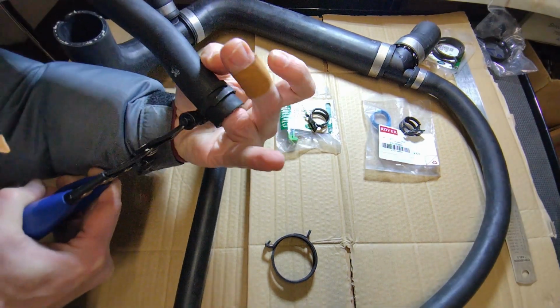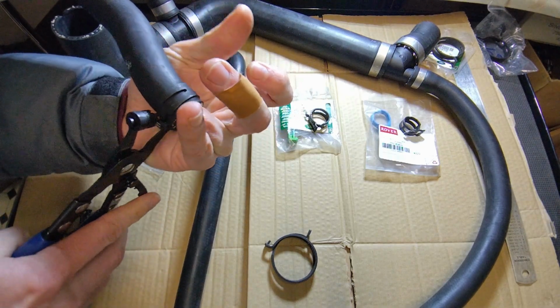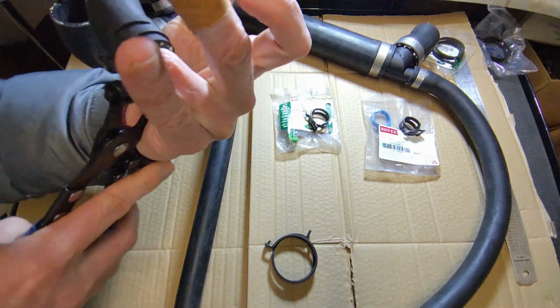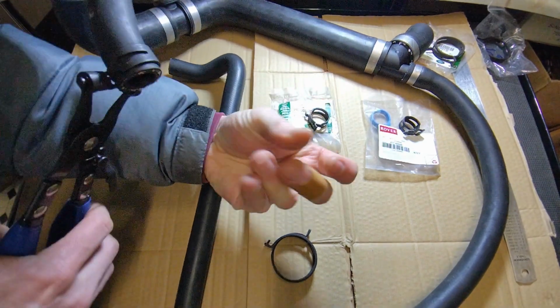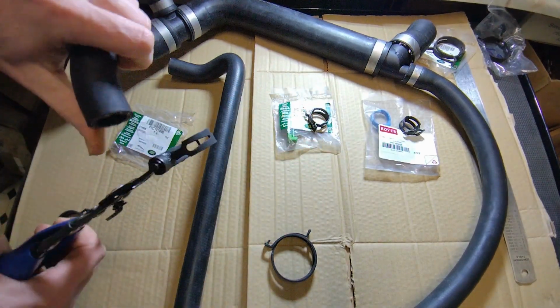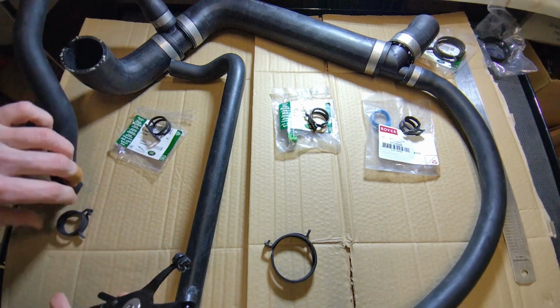I think there's a good test you can do on the pipes that are smaller. I use my ring finger and release that. That's actually quite painful. I can't get that out. The compression on that is quite strong. I wouldn't want to leave my finger there. It would start probably going pink. So that's quite a good test to see there's quite a bit of clamping force with that one, which is 27mm, and this is a 28 outside diameter pipe.